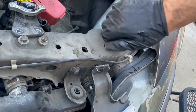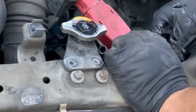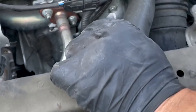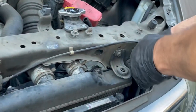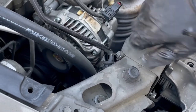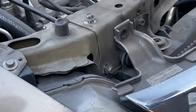Make sure nothing's in the way, then put the bolts back in — three on each side. Everything should line up just fine. Make sure to pull the radiator fill cap back above, and make sure this wire harness is not getting pinched. We won't tighten anything up completely until we get all the bolts in. Once we get all six bolts in, three on each side, make sure they all line up fine. Then tighten them down.